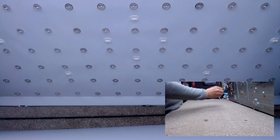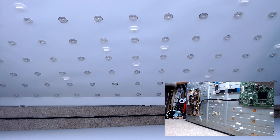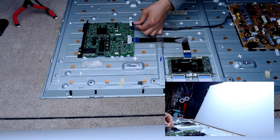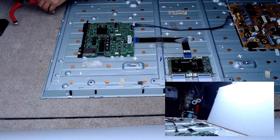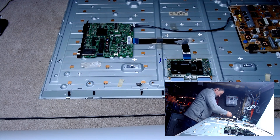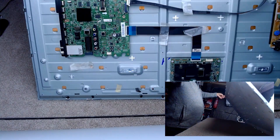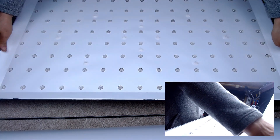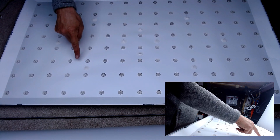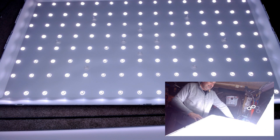To test all of the backlights we disconnect the mainboard from the power supply. You can disconnect it at either point. As I don't want to do a balancing act with the screen in front of me, I'm just going to push those in and take it out. I'm hoping to see an indication of why the top third of the screen — usually the first three strips — sometimes don't come on. I'm hoping there's a bulb or two out that I can replace. But — nothing. They are all on and they are all lit up.